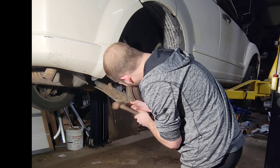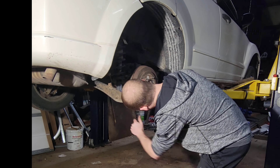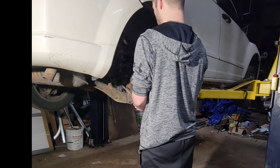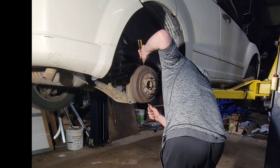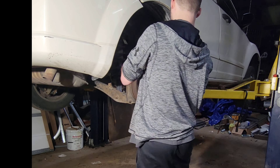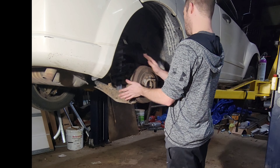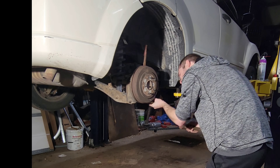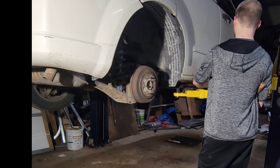This is no fun. This is probably the third or fourth time I've done this — I've done both sides before. They say you can go in the back and try to loosen your brakes, but there's no teeth on the self-adjuster in there from where I've worked on it in the past. So there was no going in and trying to loosen that up. I ended up taking a torch to it, just the little can torch this time to see if I could get by without dragging the big hose out.